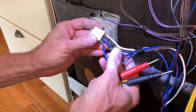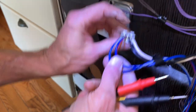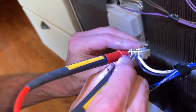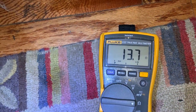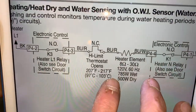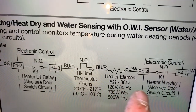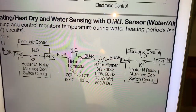P43 and P44 — that's these two blue wires right here. I'm just going to back-probe these two to make a good connection. And we're getting about 14 ohms — that's right in spec. The closed high limit should be essentially zero, and then our heater spec is anywhere from 8 to 30 ohms. So there's nothing wrong electrically with this heating circuit.